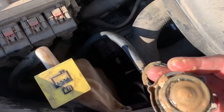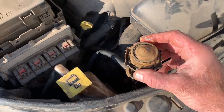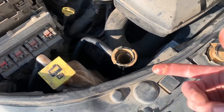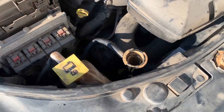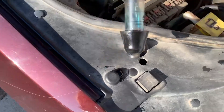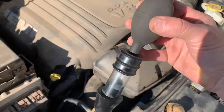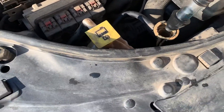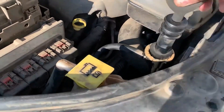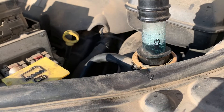That could be any number of things. If you've got a car with an oil cooler that runs through the radiator, and there's a crack in it and you get oil mixed with the coolant, that can cause overheating. So the next step is we're going to find out if it's just that by using this blue test fluid — we're going to draw air out of the radiator into this fluid, which should stay blue if there's not a problem.